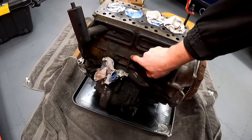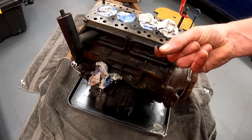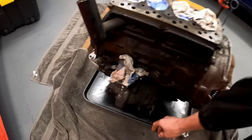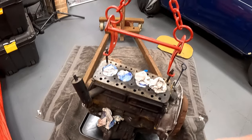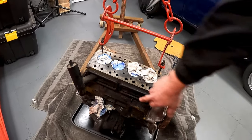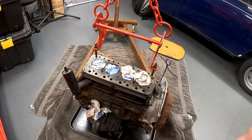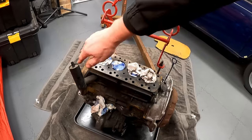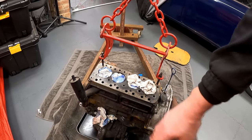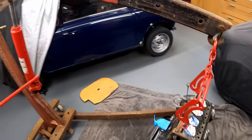This is really thick on the back here, but I think I might have mentioned in previous episodes, it's just oily dust. I think this car sat in a really dusty workshop and was probably started up once a week, and the valve chest gaskets were leaking. They would just drip down a little bit of oil across the back, more dust, bit more oil, more dust, bit more oil, and that's how it's got really thick and grimy down the back there, because it hasn't done many miles.